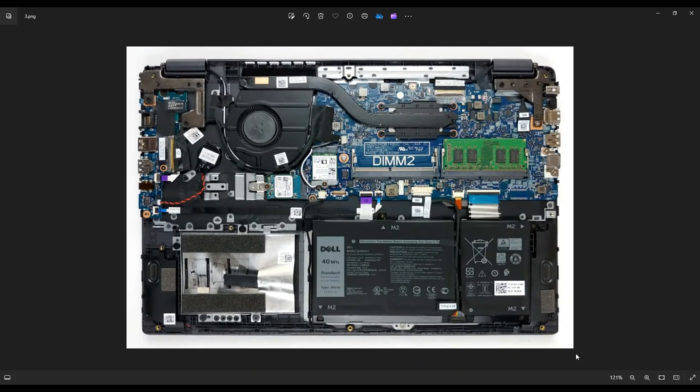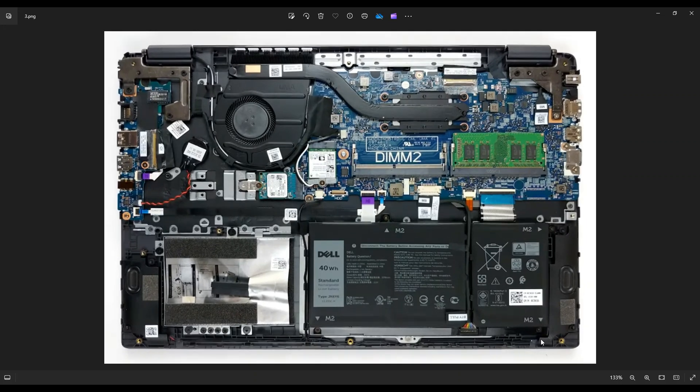So first I'll show you how to remove or unplug your battery. To get this battery out, you have four screws near each of the white triangles. The battery comes up here and plugs into the motherboard right here, so you have a choice of where you want to unplug it from. As with any cables and wires in a computer, try not to pull on the wires if at all possible — try to just manipulate the plug. This plug is easy; it's got a grip on either side. You can use your fingernails or a pry tool and wiggle that right out of that port. If you want to unplug it from the other connector, that's just a snap — it snaps right off.